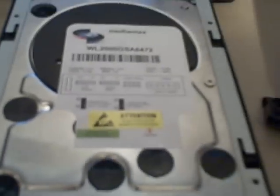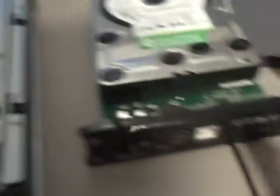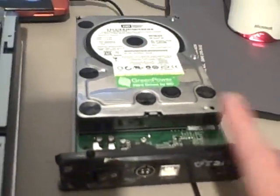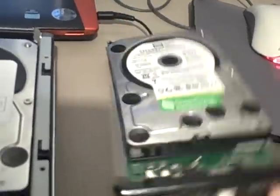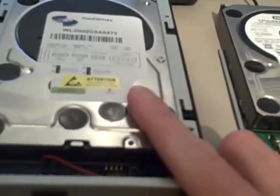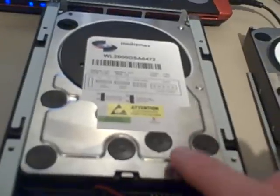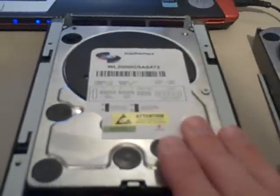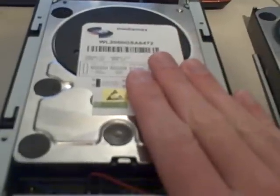I would take speed any day — I really don't care about a few more watts. But talking about watts, we should also talk about heat. The Caviar Green is in an all-metal enclosure with no fan, and it only gets up to 41 degrees Celsius being vertical — being flat, it gets a couple degrees hotter. With the Caviar Black being flat, it gets 58 to 59 degrees Celsius, and the thermal limit on the spec is 60 — so, bad idea without a fan. With the fan, this enclosure brings it down to 38 degrees Celsius. Very, very good cooling with this enclosure.